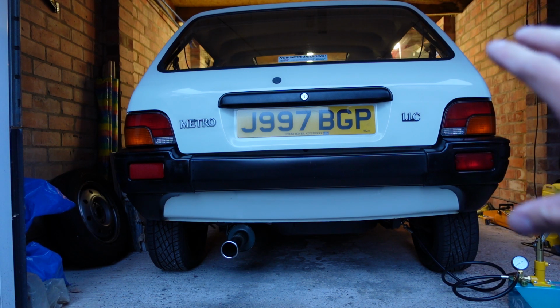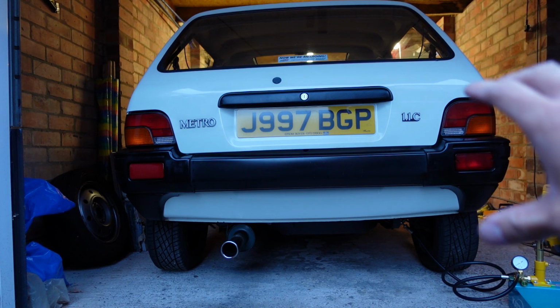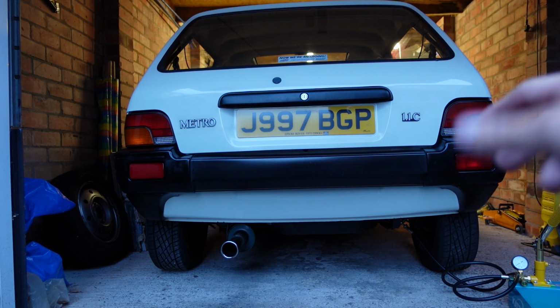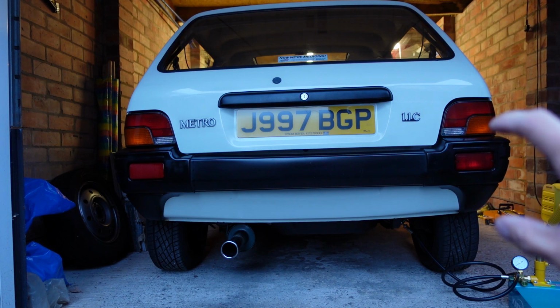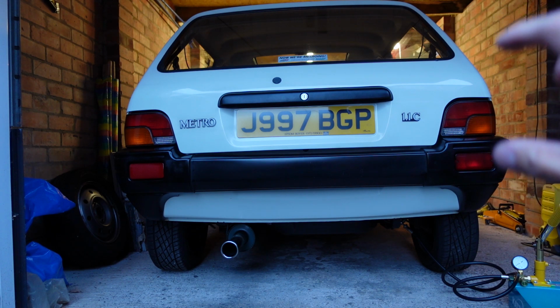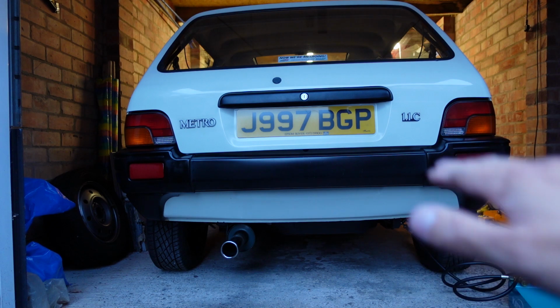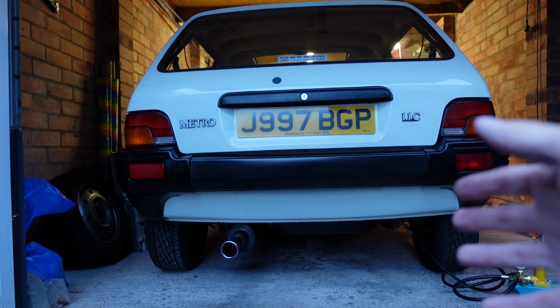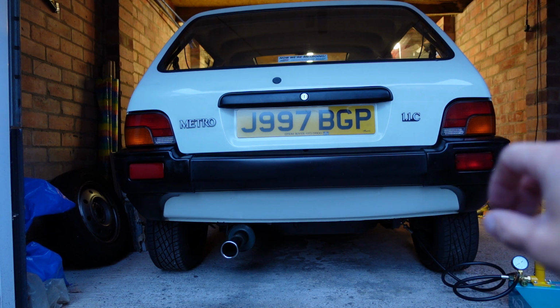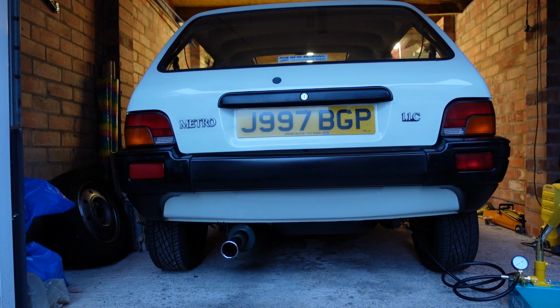And so you imagine, I mean, I'm oversimplifying again because Hydragas doesn't work in the same way as a traditional coil spring suspension does, but you've got all that extra suspension travel now waiting for you, and that much more damping, especially. That's in particular what this is giving you. It's giving you much stiffer damping. So previously my car would bounce horrifically over certain terrains, and now it won't do that. It'll remain much more stable on the road, and of course that's what we want.